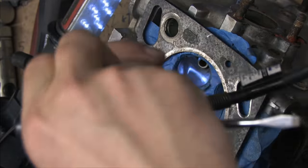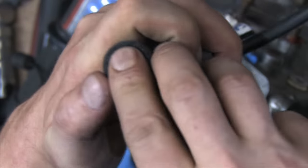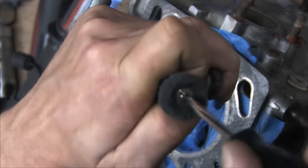Oh yeah. The harder you press on them, the faster they wear, so you're best off getting what you can reach while they're new with light pressure, and then go back to the tight spaces after it's worn down. That way they'll last you longer, you get farther with them. Moving on to the medium buff.